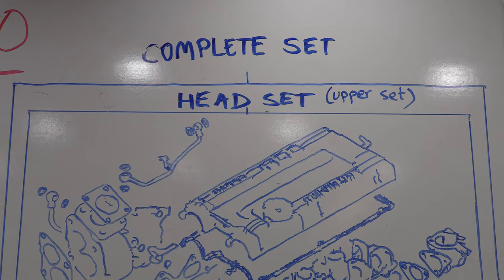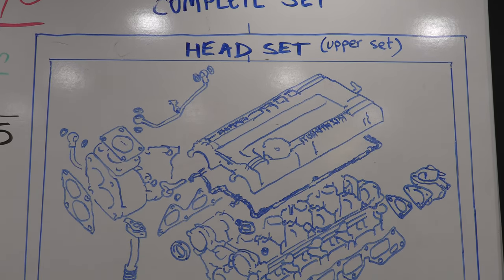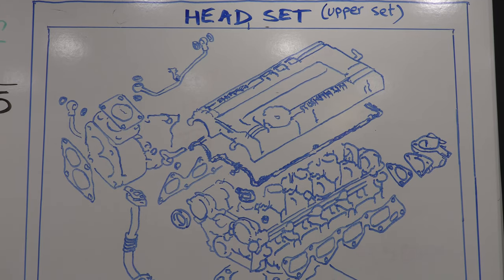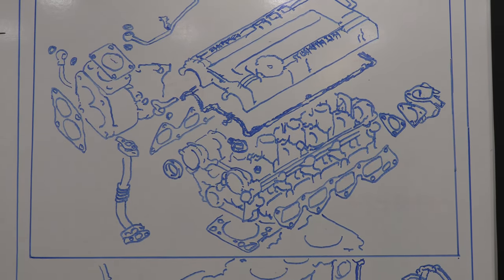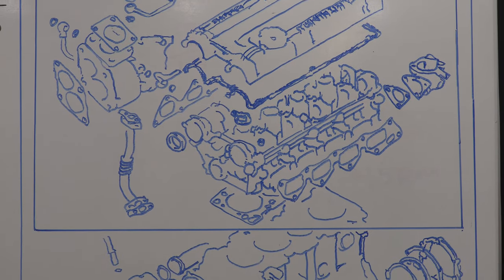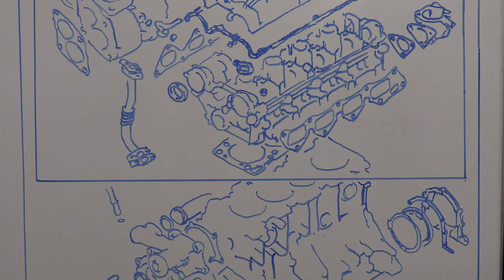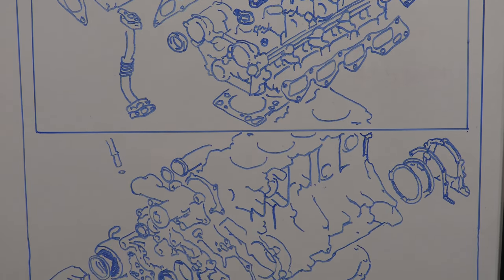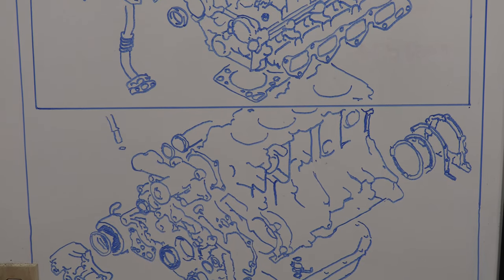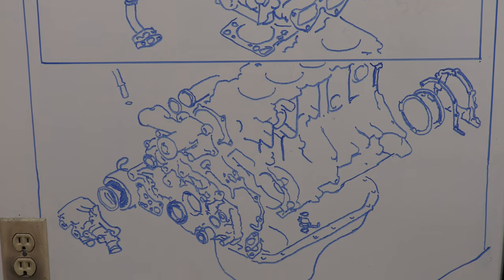For instance, Parts Group 11 is the engine block, Section 090 is just the overhaul gasket set. It's all the things that go in between the stuff. It's one part number that you can use to ensure that you're getting all of the gaskets and seals packaged together. Because the build for my GSX consists of the best pieces of both the 6-bolt and the 7-bolt platforms, no cookie-cutter factory kit is ever going to suffice for me. But for everyone else, this is a really good place to start.